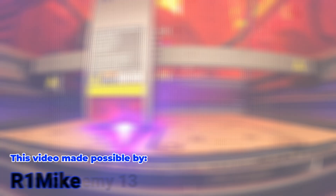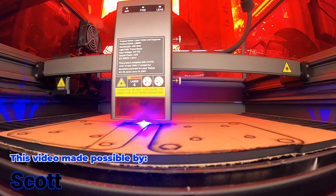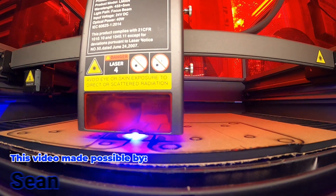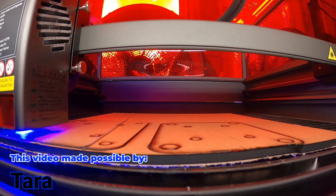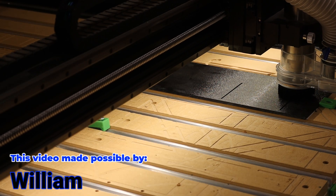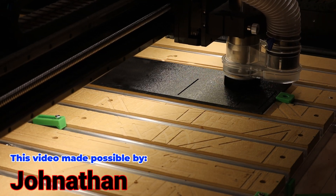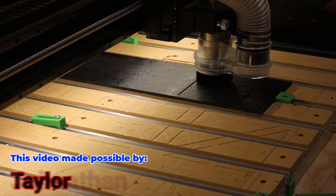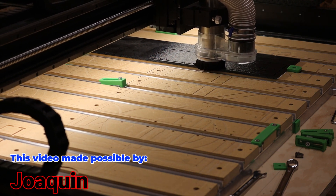So why not lay out a design on the computer and cut it with a laser? Well, you can't cut ABS on a laser — not only does it release toxic gas, the fumes are not good for the laser. Pretty much anything you cut with a laser is going to release something toxic, so ventilation is important. So it's back over to the CNC where, in addition to cutting the shape, I'm going to add some shallow notches on the places where I need to bend the plastic. That way I know where to bend and it'll be a little bit easier. That's just a matter of adding some heat with a heat gun.